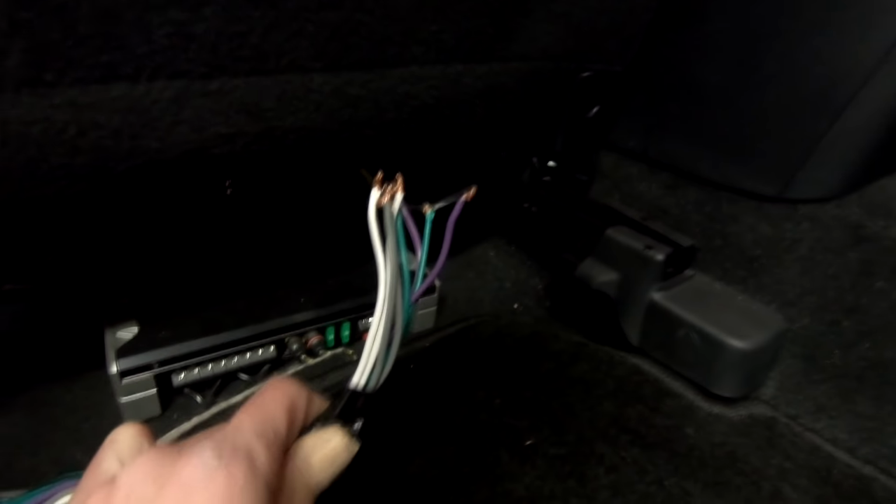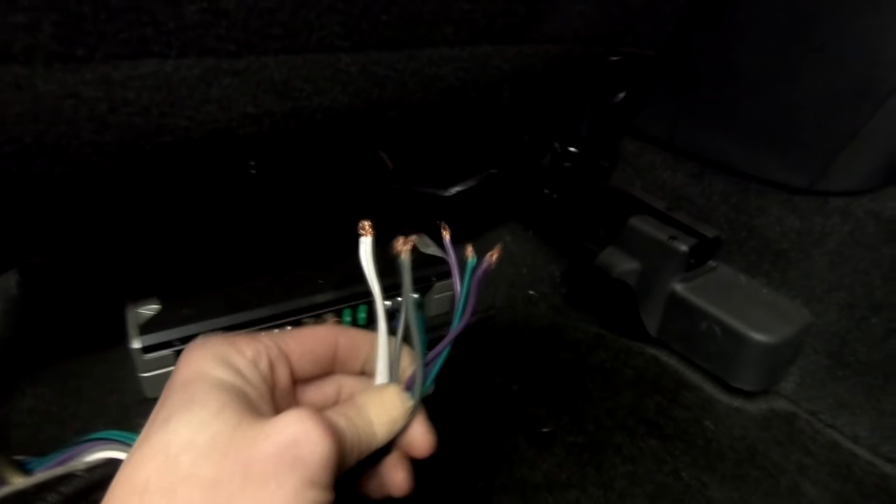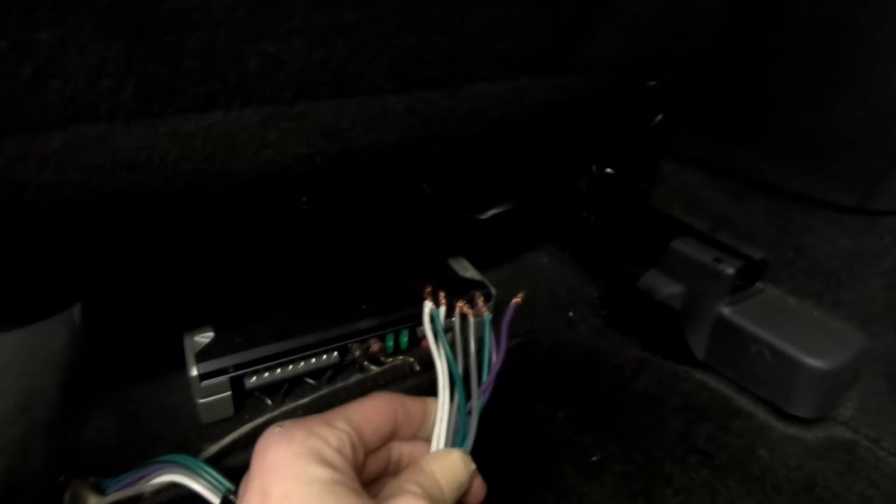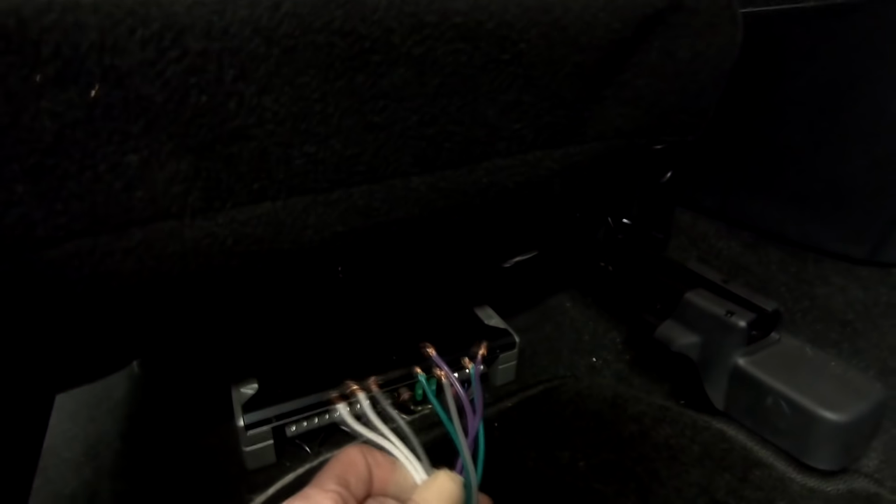So this time we've got to get the little four channel put in and get that hooked up to the rears. So, show you what we've got sitting here now. There's our four channel that's in here now running the fronts. So this is the wiring that was there from the previous install, which is a pretty decent gauge. And that was actually piggybacked up into the back of the head unit itself. So I am going to reuse those for the rears, which are just running the factory wires, but will be fine for what we're doing.